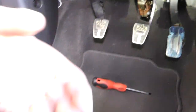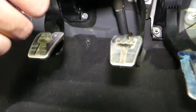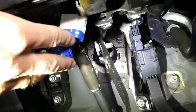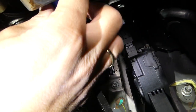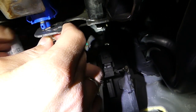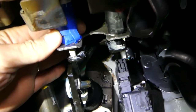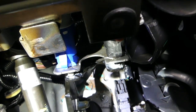Get your new switch. First, find your wire and connect it — make sure it clicks all the way in. It goes in only one certain way, so make sure it goes into the slots. Press the brake pedal, align the switch, and make sure everything fits properly. Then turn it clockwise to lock it in place. Everything is installed — that's the whole procedure. Thanks for watching, see you next time.